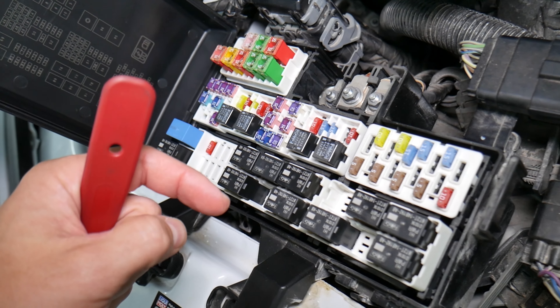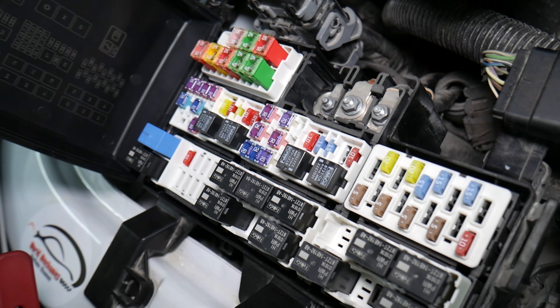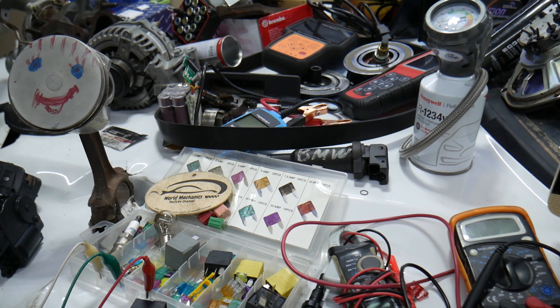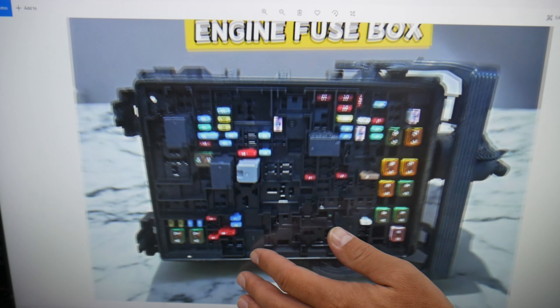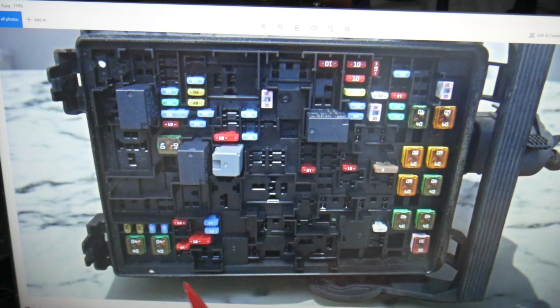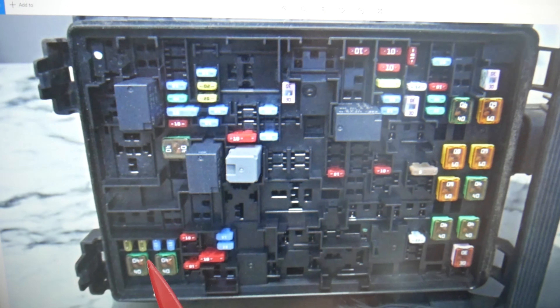We'll put a link to a special video that will teach you how to test fuses and how to check relays very easily as well. So check it out — it will be in the description of the video below. Here, we need to check the radiator fan fuses and relays first. If we zoom in, the first one that we're talking about is fuse 116 right here. Then, you need to check fuse 123. These two fuses.